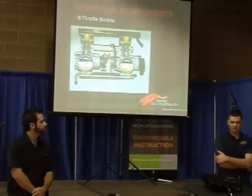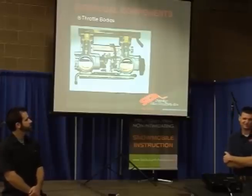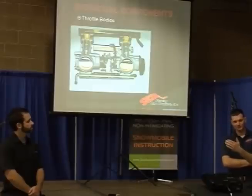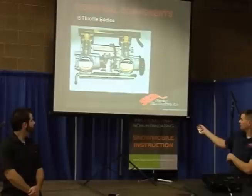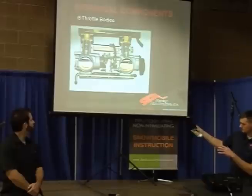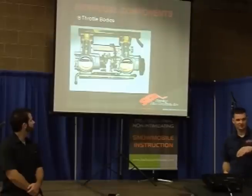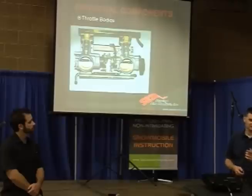We'll talk about air. They're using a throttle body which is basically just like a carburetor, only we're using a butterfly valve instead of a slide. There are a couple of fuel injection systems that do use a slide, but pretty much everybody's using a butterfly valve, and the reason is because they have to be able to sense what the throttle position is. At idle that would be 0%, at wide open throttle that would be 100%. They can do that with a rod that runs through the center and a sensor on the end. You'll see that black box on the end right here — that's the throttle positioning sensor. That rod, when it's turned, the sensor can measure the amount and send a certain voltage back to the ECU, indicating whether the throttle position is being raised or lowered. That's why they use a butterfly instead of a slide in most cases.